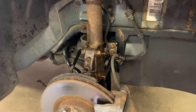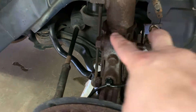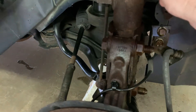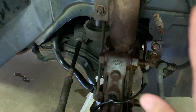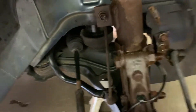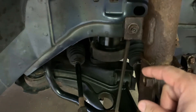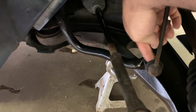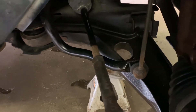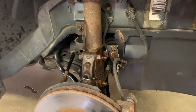Hopefully this side won't be as difficult. This one is a lot simpler than the 2008 Ford Taurus I did this weekend. As you can see, it's just the two bolts holding the strut mount assembly right onto the knuckle, plus one other bolt because it's attached to the assembly. Of course we have to get the sway bar link out. It's pretty straightforward, so this video will be a lot shorter than the Taurus.